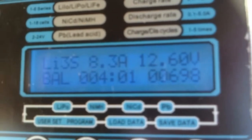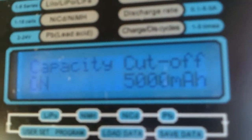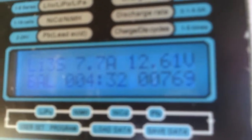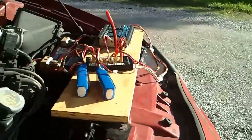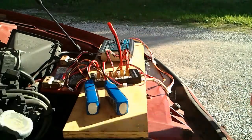Amperage is rolling down a little due to constant current/constant voltage. It is putting current into those cells pretty quick. Let's check internal temps — 105 degrees internal temperature. We started at 78 and a little over four minutes into the charge we're at 105 degrees. I'm going to set the camera back and when I edit this video I'll fast forward through this section, but still do it all in one shot. I'll be back in a few minutes and we'll check the internal temperature again — charge time is at about 4 minutes 55 seconds.